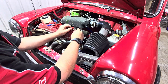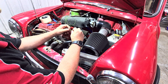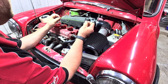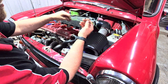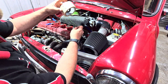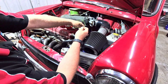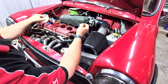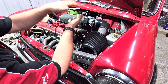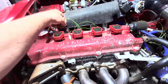We've got to build a dummy harness - whether it's to post to me or someone else, or maybe you want to build it in the conservatory out of the cold. You can use wire, string, or whatever you have that's plentiful and cheap. Getting a dummy harness through the post is brilliant - it gives all the lengths for where the coils go, the injectors, the lambda, where the ECU goes. Use masking tape to label each end - lambda, injector one, TPS - and insulation tape for transitions, like where you split off four ways for the coils. Label everything so it doesn't get mixed up.